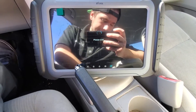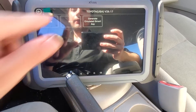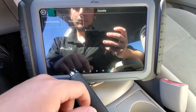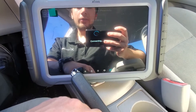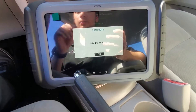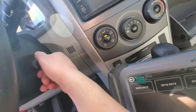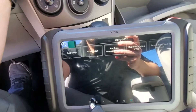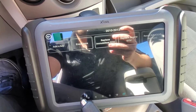Toyota USA is here at the top. We're going to go to Key By Vehicle, then Corolla non-proximity, then 2010 to 2013. This vehicle is a 2013. It failed to connect — the reason why is because I don't have the ignition on. So I'm going to take the original working key, switch the ignition on, hit 2010 to 2013, and now we're in the system.